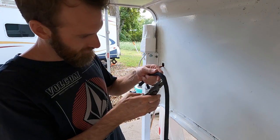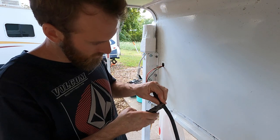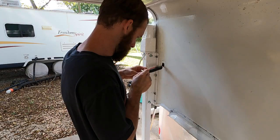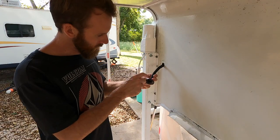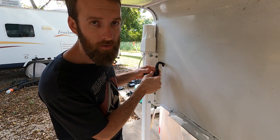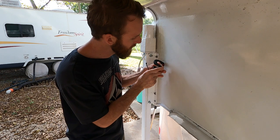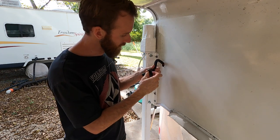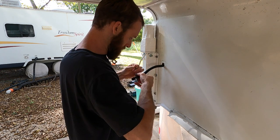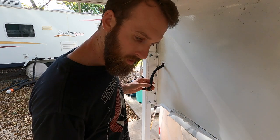We're gonna cut off a section of this. It's about all we need right there. All right, so you wanna have the crease on this cover facing in the direction that you're gonna bend your wires. That way when the wires bend, it's protecting the area that matters the most. Go ahead and put a zip tie on that. Make sure it stays put, and that's it.